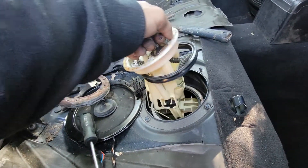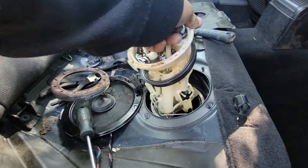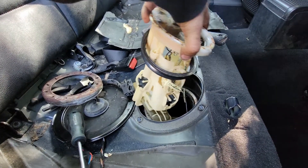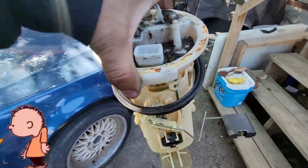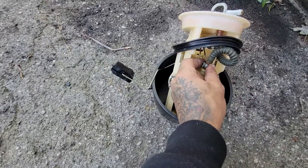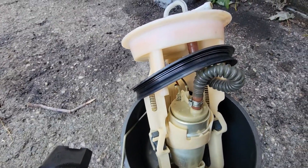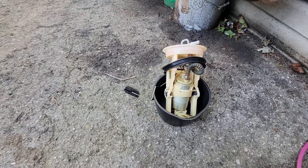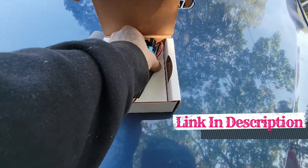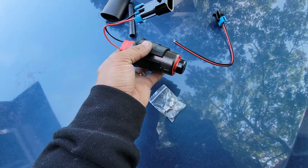Here it is. I'm just trying not to make a mess - it's gonna be a mess if you're not careful. Got the bobber out of there. That's out and I put it somewhere where I can let it leak. What we're after here is this fuel pump right there. We need to take it out of this slot, remove this hose, remove the electrical connectors inside, and then slip in our new high-flow performance fuel pump with a new hose, new electrical connectors, and this sleeve insert. Here is our new Aeromotive fuel pump - we have a hose, electrical connectors, hose clamps, the pump itself, and this insert sleeve that was 3D printed by my buddy. We're gonna put a clamp on that and it will hold it in place nice.